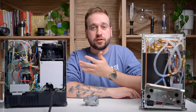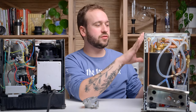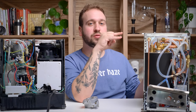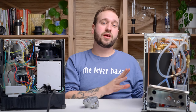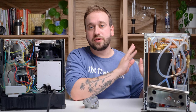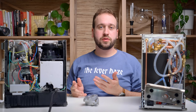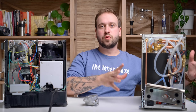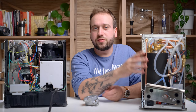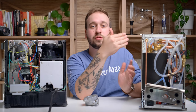Going up from the heat exchange system, we get to dual boilers. These work by having two boilers — one just for brew water and one just for steam — giving you full control over both. Each can be dialed in independently. You can brew and steam at the same time and set the temperatures independently. On some machines you can even turn off the steam boiler entirely to save energy. The downsides are that dual boilers are more expensive and sometimes physically larger, and they can use smaller individual boilers, meaning less steam power than a heat exchanger.